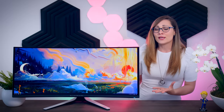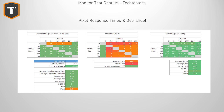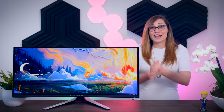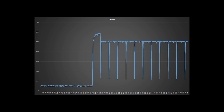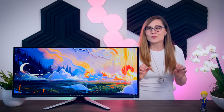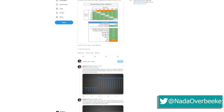Optimus514 asked about response times from my review. Most transitions show one millisecond or less, but some black-to-gray transitions looked a lot worse, showing around five milliseconds. The question is whether you'll experience that as black smearing, which is a big issue with many VA monitors — and the answer is no. This is nothing like black smearing on VA panels. It actually doesn't take five milliseconds to hit the target; it responds quite instantaneously but overshoots the target slightly before showing it perfectly on the next frame. This all happens within a single frame so you won't really notice it. I wrote a longer thread on Twitter covering this topic in more depth — link is in the description.